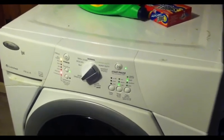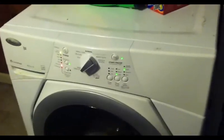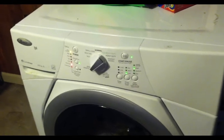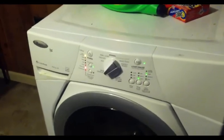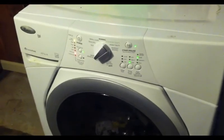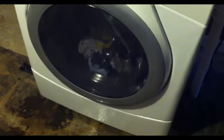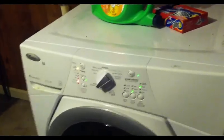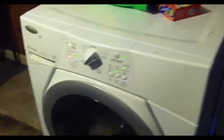We're up over about two minutes doing this. I was able to find the user manual online but I haven't found the service manual yet. At the very least I'm going to have to take this thing apart and clean out the internal drain - I think maybe it's clogged with debris. That doesn't quite make sense if it was draining while the rinse cycle was on, so I have to see what's being done differently when it's just draining alone.